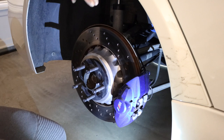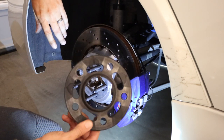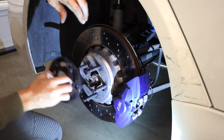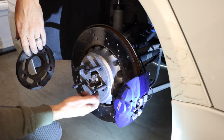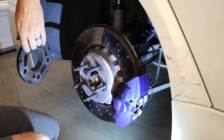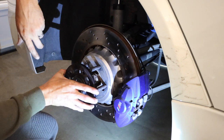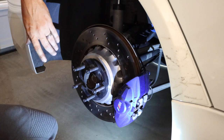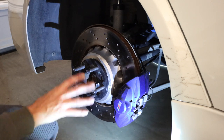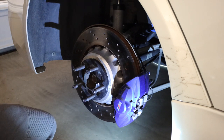Now we're on the right rear. One thing I didn't mention up front — I am running the Turner 12.5mm spacers front and rear, it's actually called the Turner Flush Kit. I also have 90mm studs in there. I went with the 90mm because in my research the 75mm stud would barely accommodate up to a 12mm spacer and I didn't want that. The studs hardly even stick out of the rim, and going to the track and swapping tires makes it so much easier with the studs. I highly recommend looking into a pair of these.